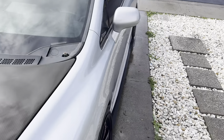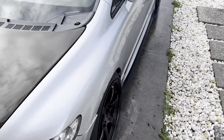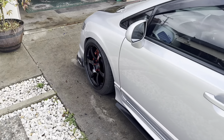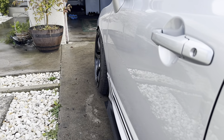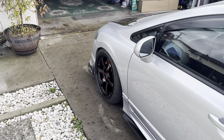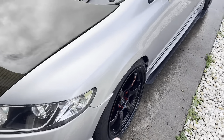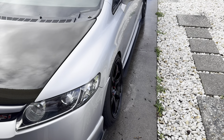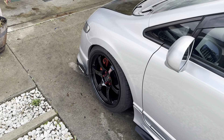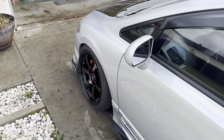The fitment is actually really really good for the spec — I was expecting it to be almost too aggressive. But these actually fit fine, and if you're not running a spacer or Brembos in the front, you're going to be chilling honestly. Because technically I actually have 20mm with the spacer in the front, plus I have a 5mm spacer behind my rotors to center the rotor on the brake caliper — so technically this is an additional minus 20 offset in the front, making this more like a plus 18. So I think if you get plus 38 you'll be fine — you probably won't even need to add much camber to the front. You'll probably have to roll your fenders or cut out the little tab, but that's just a given if you want any type of good fitment on these cars.